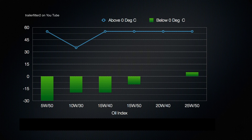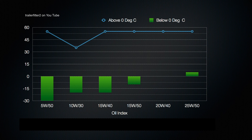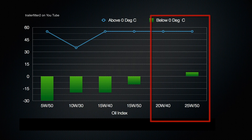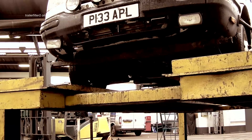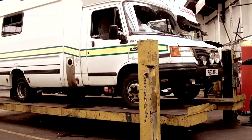For those of us in the UK, we're looking at temperatures that will probably never reach below minus 10 or 15 degrees centigrade and won't get that hot either. So what we usually use is something like 15W40 or 15W50. At the extreme, 25W50 is suitable for an environment that never gets cold. This is quite an in-depth subject, but basically if you're going to change your oil and don't know what to use, buy from somebody who supplies oil and Land Rover parts.